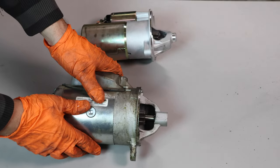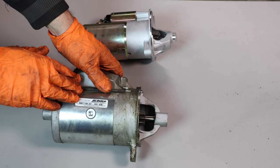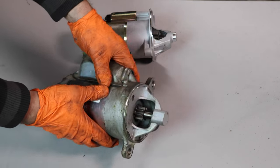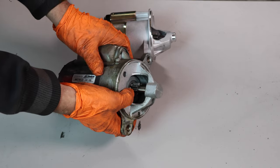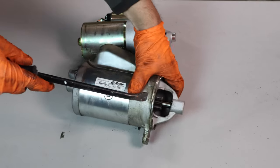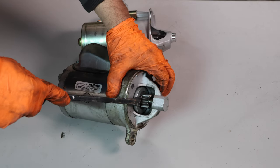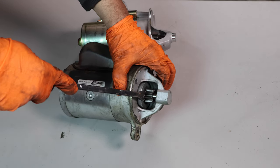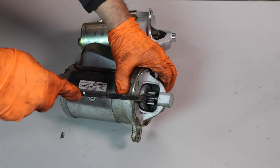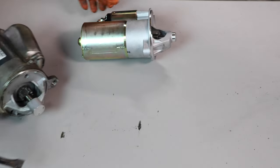As you can tell, this is a fairly new starter, and I've tried all the different manufacturers — from remanufactured Ford to some AC Delco ones. They actually make ones that will fit the Fords. But really what goes bad is the solenoid, which actually engages this ring gear to the flywheel. They all seem to never have enough force to pull this gear all the way out and spin the flywheel — they just kind of lock up at a certain spot and keep spinning, grinding down your flywheel or flex plate. So again, these cheap starters aren't really worth it. Let's go with the performance edition.